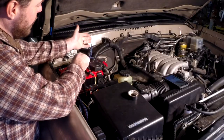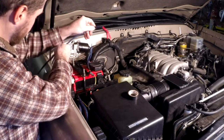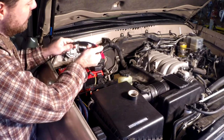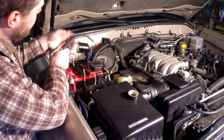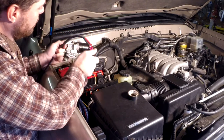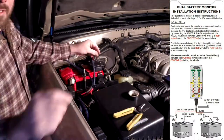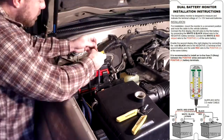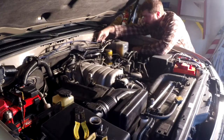It's another one where you've got to plan really well. I've got a couple that are going to go over these connectors here, and then I have the larger one — that's going to slide over both of these, and this, and this, and this blue sheathing — so this has to cover all of this. The battery monitor requires a fused positive lead and a negative lead to each of the batteries.